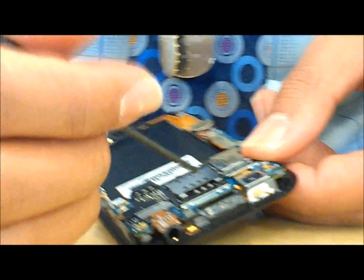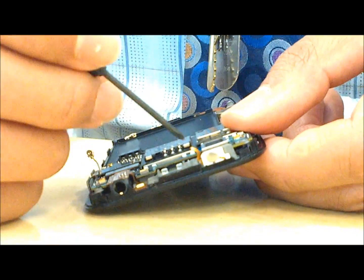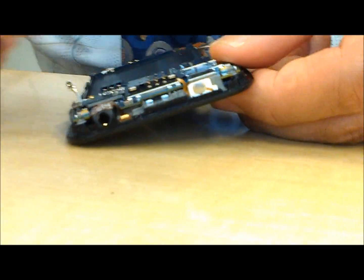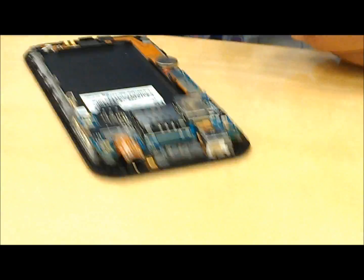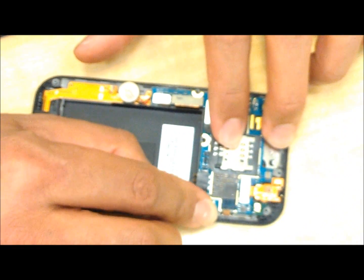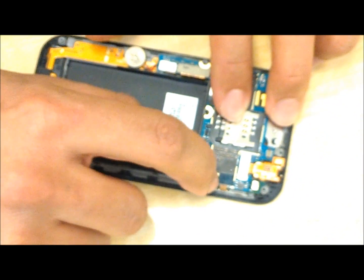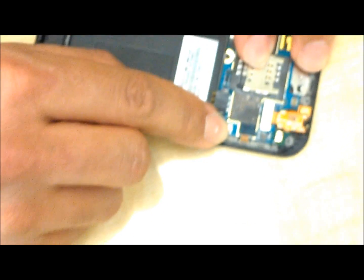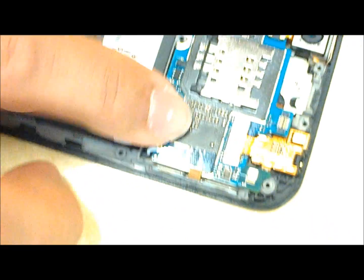You can see right there a gray piece of metal that kind of holds that in place. There's another similar one for the whole power button area — there's just glue down there, so if you take a flat tool and press it up off that metal you'd be fine. Reconnect — the white cable to the female housing slips over the male. Press it down and double check all of them are back connected.